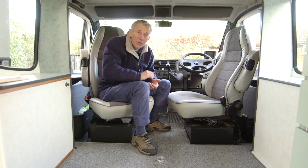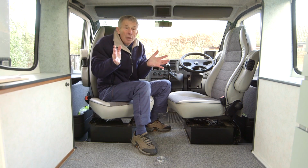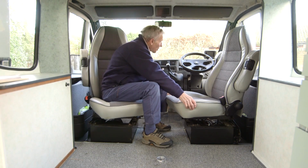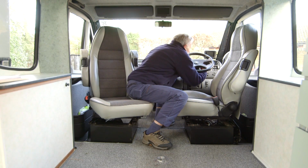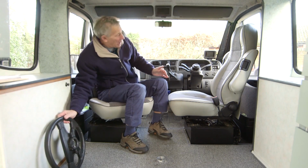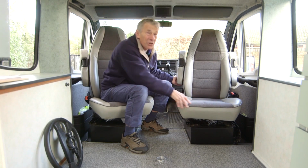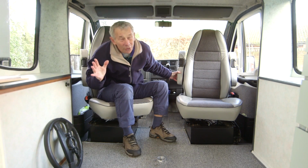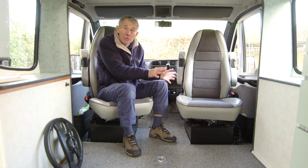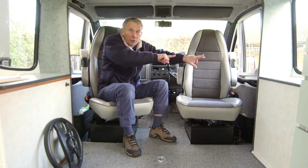Well, in motorhomes that were built around 2000 and a few years afterwards, yes, there was, because the steering wheels didn't have airbags. And there were specialists who would sell you this kind of arrangement where the steering wheel simply came off and then you had space to complete the operation. Now, in the last 2 or 3 years, the base vehicle manufacturers have solved this by rearranging the geometry, and you don't need to remove the wheel to swivel the seat.